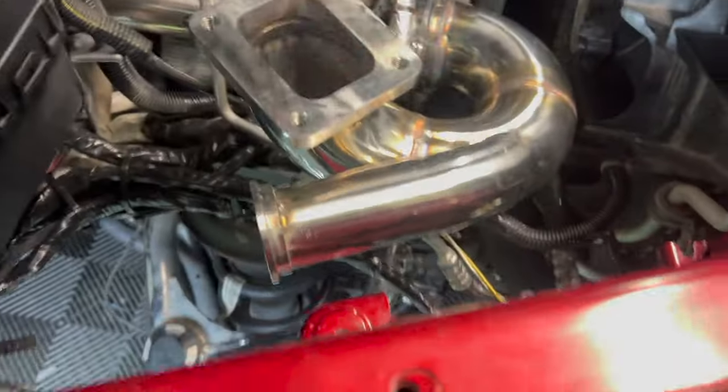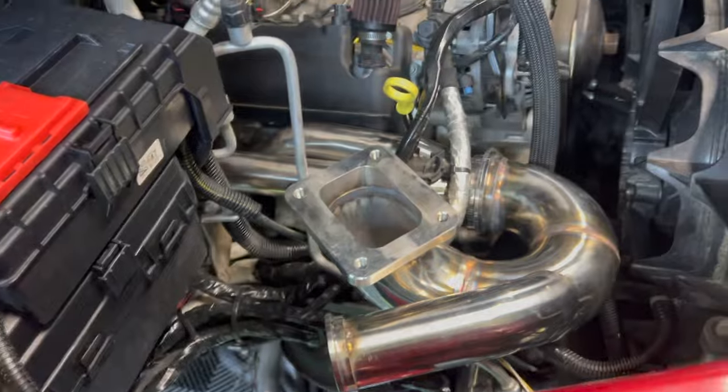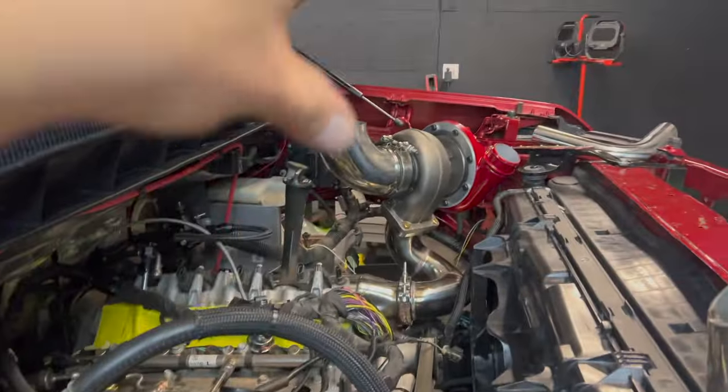After hours of work we've finally got this tacked up — we have not fully welded yet but this is our wastegate going right here straight up. This took way too long. Not only did shaping the pipe take forever but getting the hole drilled into the pipe for it — and I still got a pretty decent size gap to fill. We finally got it done. I'm going to fully weld this side, get the turbo back mounted so that I can get really good measurements of exactly what I've got to duplicate. Since this one's not symmetrical, it's not just 'do the exact same thing' — it's do it, make sure it works, then go over here and replicate it as best as we can.